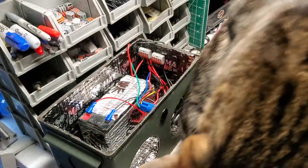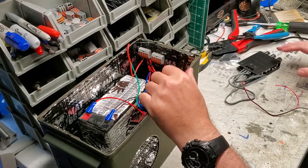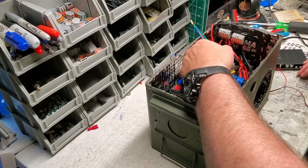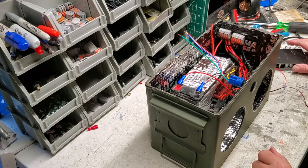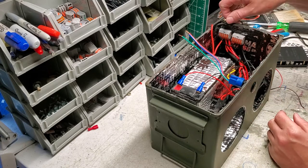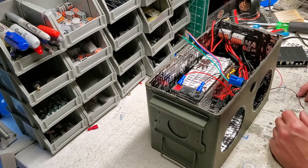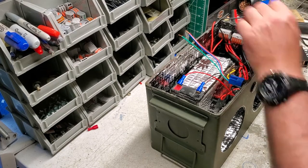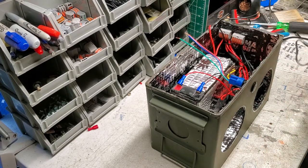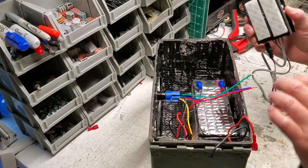We are not going to do a two-hour video. We do have to do a music portion of the video. Now, what we have in here is our switch is already in here, and we have our amp. We have our positive and negative terminals. We'll need to hook up our positive wire to a fuse and we'll do that in just a minute. Let's go ahead and get this amp put in - we've got it on the Velcro.